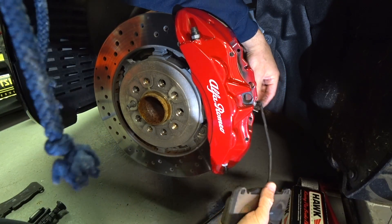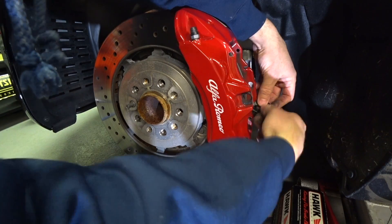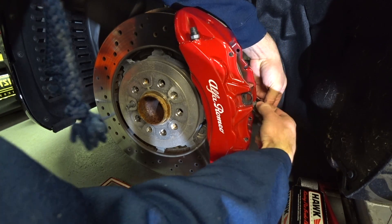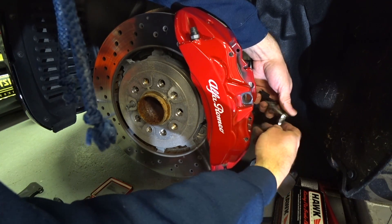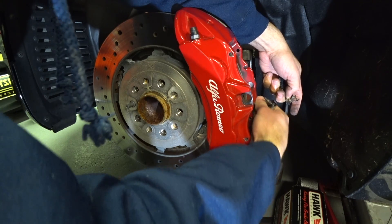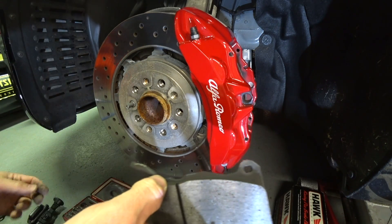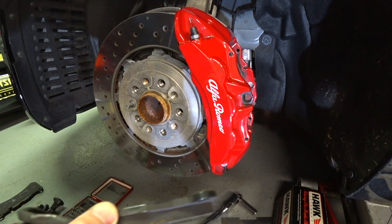We're going to have to take this little clip out — let me grab an allen key. We're going to remove this bracket because if I try to pry off the brake pad sensor harness it's probably going to snap since it's so cold out and the plastics are brittle. We'll reinstall that screw since it has loctite on it and I don't want water to cause corrosion. This is the factory brake pad with the sensor wire embedded into the back, which grounds out and triggers a brake pad fault if you wore them down to the backing plate.